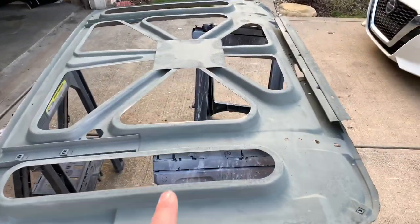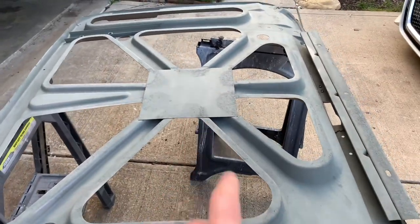Got that all sanded up, primed, and got a nice layer of self-etching primer on both the inner structure and the skin itself. But something that needs some serious attention here is the inside of the trunk — as you can see, I've got some rot through to the outer skin, so I'm going to have to make a metal panel for that.